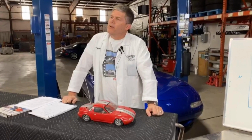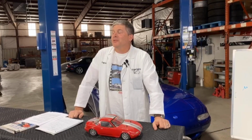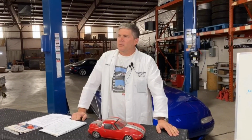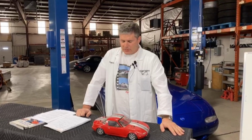Doesn't altitude affect your brake cooling and brake fade? Such as comparing High Plains versus Laguna Seca. Does altitude affect your cooling for brake fade? The answer is yeah, of course. And this is High Plains versus Laguna Seca because people in California don't like it if you say that theirs is not the most of something. One of the reasons High Plains is hard on brakes is because there's just less air to cool the brakes with. That's a legitimate problem. High Plains Raceway will stay at that altitude, and Laguna Seca will stay at its altitude, so it is a factor.